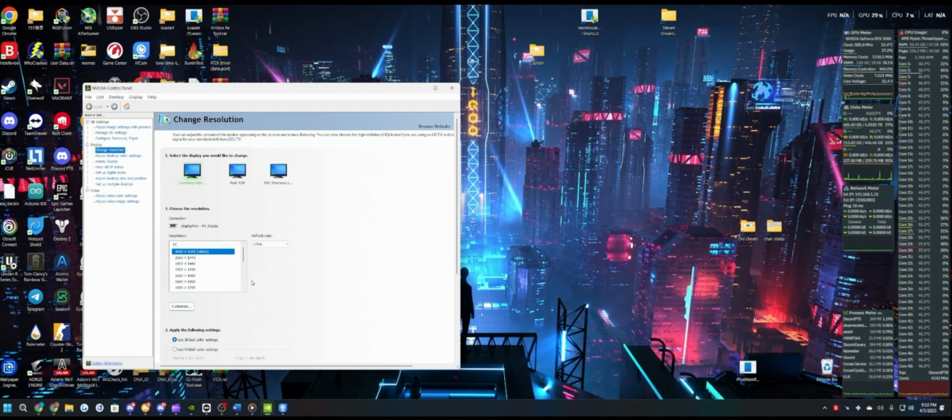A lot of the issues when it comes to a fuser can be your monitor doing a lot of tricks to actually get the hertz or resolution, and it's actually not natively doing it, which again, you will have to do a lot of testing on your own to get it to work. For example, my Acer X34 can only do 50 Hz with the V6 fuser, and my Samsung Odyssey G8 can only do 100 Hz with a V6 with the default EDID that has no driver for the display. If I flash my EDID, it will not give any picture.